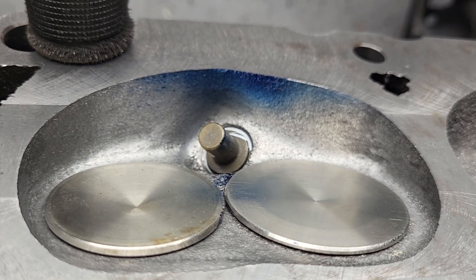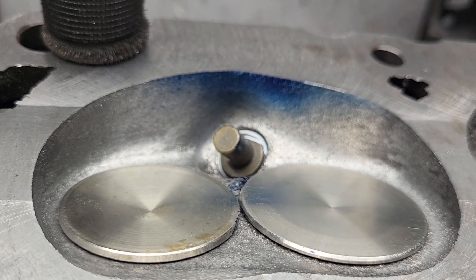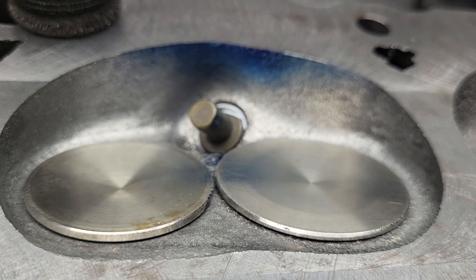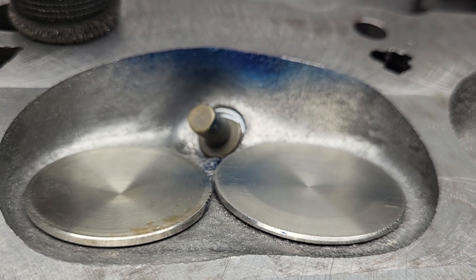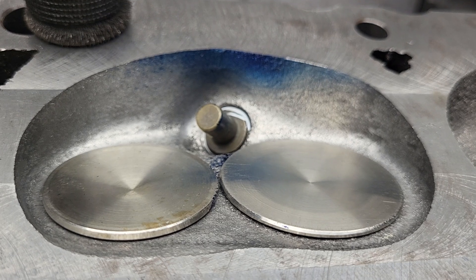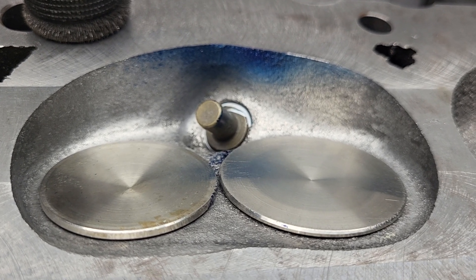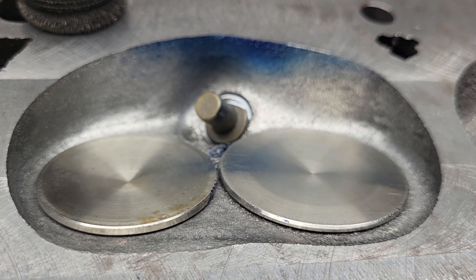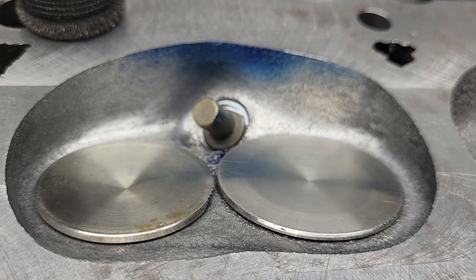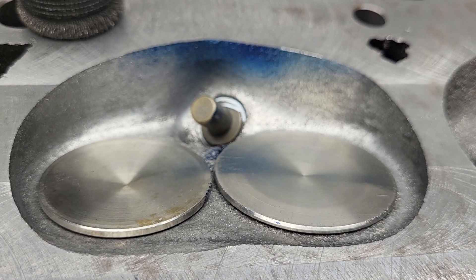The smaller valves are a problem. I actually found on Stan Weiss' site — there are two of these cylinder heads. They're C6 FE heads. They're in the wrong spot on his chart; they're in the FE section. How do I know they're the right ones? Well, they're 1.94, 1.6s. I don't believe any FE came with that size valve. If I'm wrong, let me know guys.